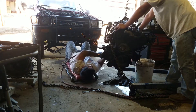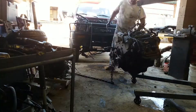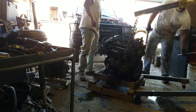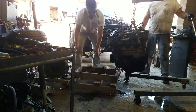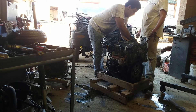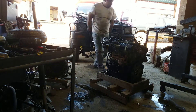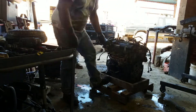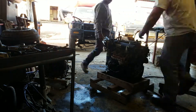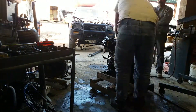I do end up replacing the entire lower intake manifold from the existing engine and transferring it onto the new engine. The reason for that is because my old truck had a 390,000-mile engine — when I reused that lower manifold I broke injectors, broke clips, and got a lot of leaks everywhere. That's something I have to replace and refurbish, because any kind of leak on a 3VZE can cause a fire, and you really don't want a fire after you've spent all this time working on it.